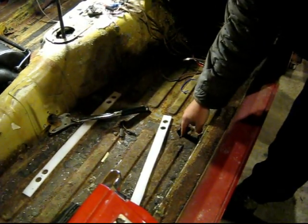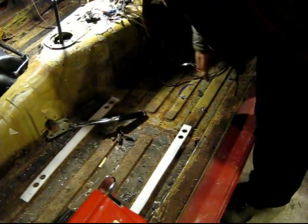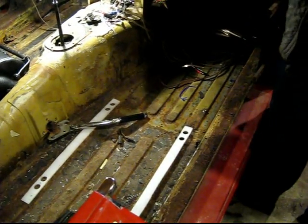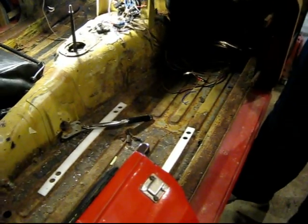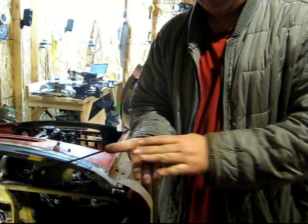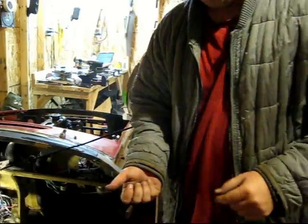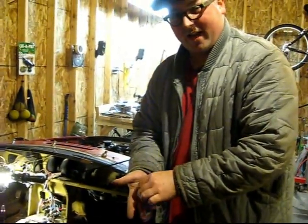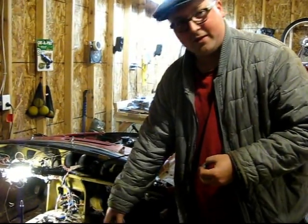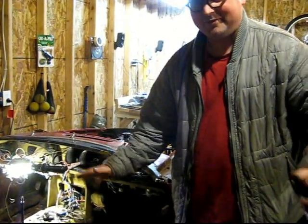This hole is a little bit big, so that one was not attached. I've got the same deal going on the other side with one of them too. Within there, there are these metal spacers that sit within the holes, and each one has a bolt that goes through them — two in front, two in back. Easiest way to do it: move your seat all the way back, unbolt the front two, move your seat all the way forward, unbolt the back two, and that's it. The seat comes right out.